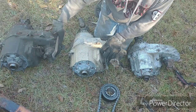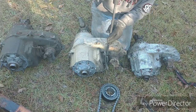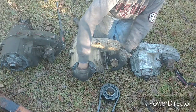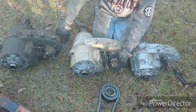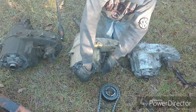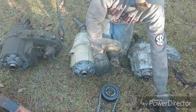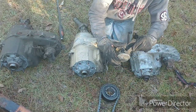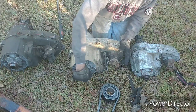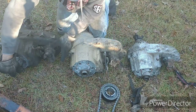Some people are offering twin-stick conversions for these, or you just get underneath it with a wrench. Right now it's in 2-wheel drive. Pull that little lever — that's what the diaphragm and vacuum engage, pulling this in — and now you have 4-wheel drive. Same thing on this one: 4-wheel drive.